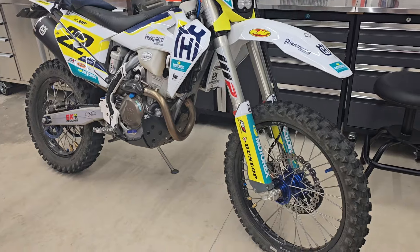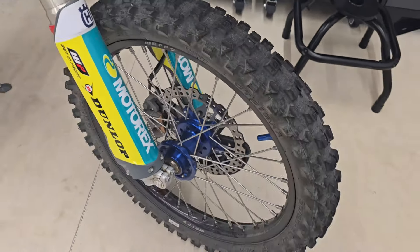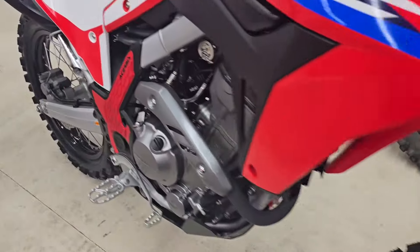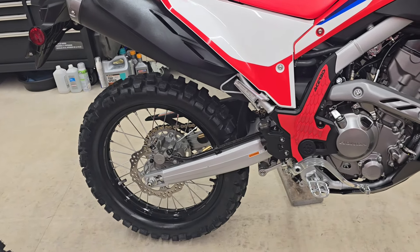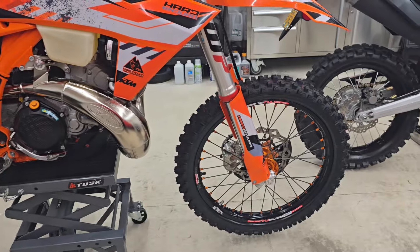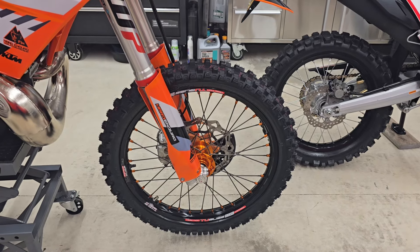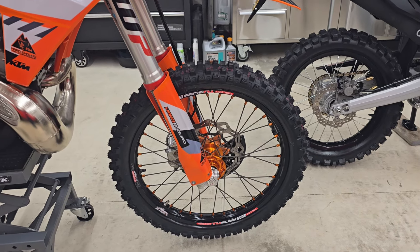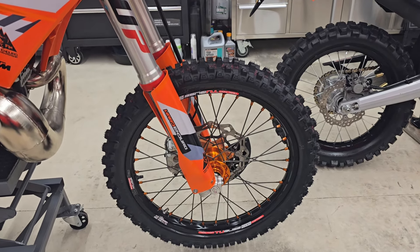A quick word on tire installation: the Golden Tires are a nice soft rubber — they spoon on so easy, they're my favorite tires to install and I never struggle with them. The Tusk D-Sports are a little firmer rubber so you have to work at them a bit more, which makes sense since they hold up to pavement better. The Bridgestone is somewhere in the middle — I have to make sure I'm in the drop-dead center on the opposite side before finishing the bead, so I'd call it moderately difficult.